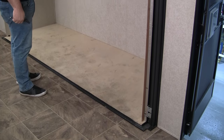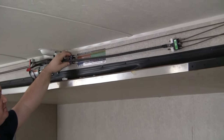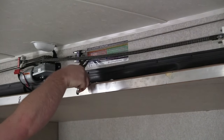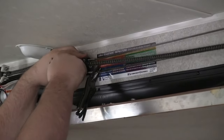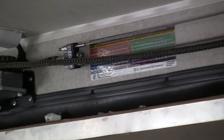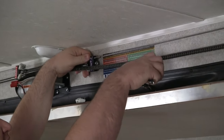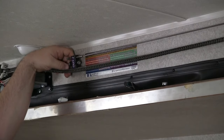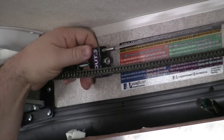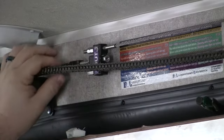After tightening our out bottom cable, the adjustment brackets are kicked at a slight angle. It's really important to match the tension of these two cables because over time the adjustment bracket can turn sideways and create a collision between the two brackets. So I'm simply going to tighten up this out top cable until the bracket is sitting straight up and down. To keep the bracket straight, I'll verify that my chain lock nut is locked in place. If I can spin the jam nut by hand, it's not tight enough. I'll run the jam nut to the adjustment bracket and tighten it on the adjustment side so the bracket is straight up and down with the face of the chain.